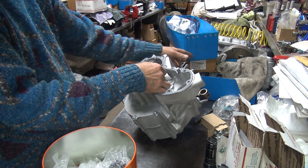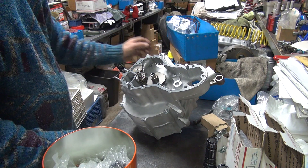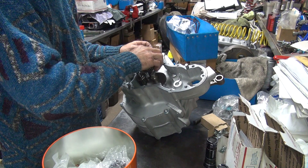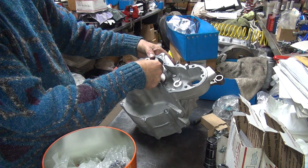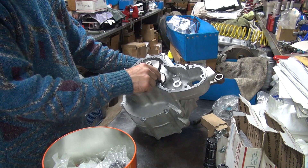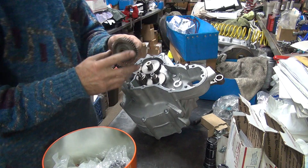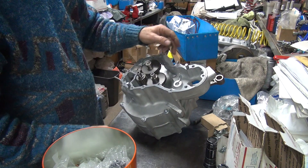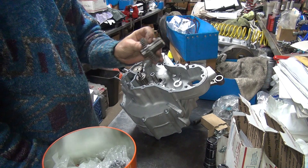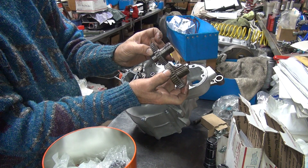Probably should time this. Do we need to? We're checking stuff, so let me time it. Time this too. Two marks are right there. We're doing like a full lock up here — that means we pretend we're doing it correctly. This gear has the spacer built in, so you don't need it. This is our stock gear here, this is the new Taiwan Teddy gear. It's different looking. This is how the gear teeth are going opposite, because this is the reverse rotation for electronic ignition.